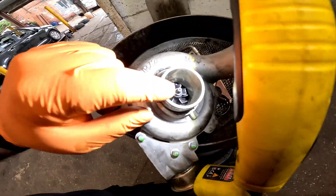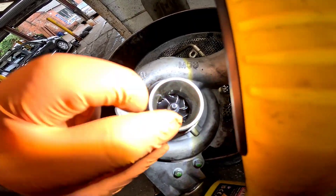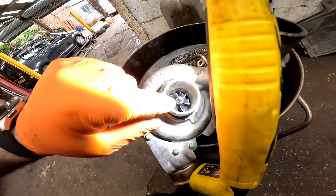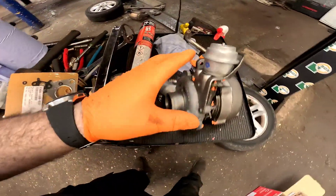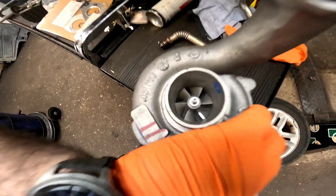With a little bit of magic, that turbine is off and as you can see there's extensive damage to the impellers. That whining noise you get — what it is, is those little fins because they're not smooth and all broken up, they can't cut through the air, so it's causing a turbulent sort of noise. But as you can see we've got the brand new turbine here which is ready to go on, looking just that little bit better.